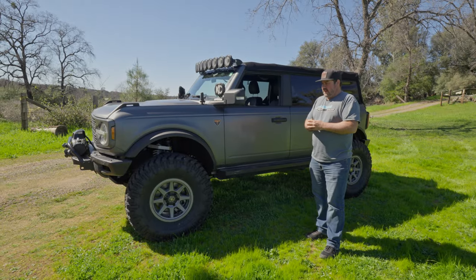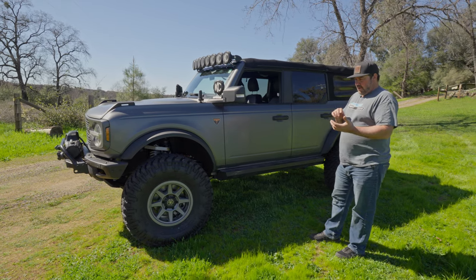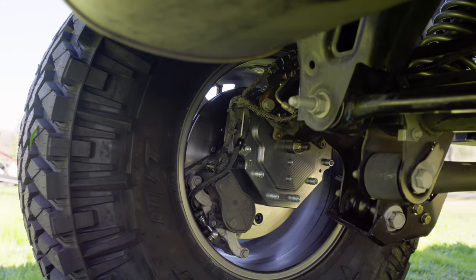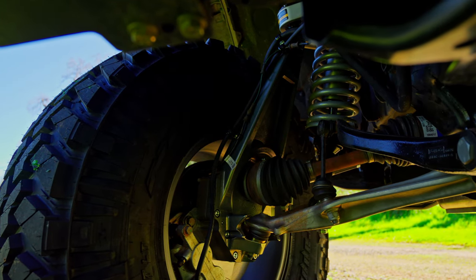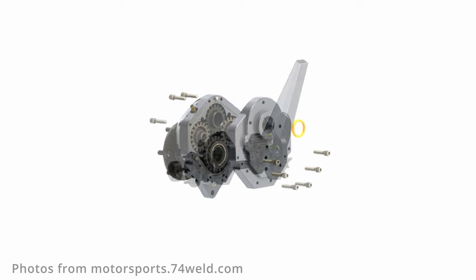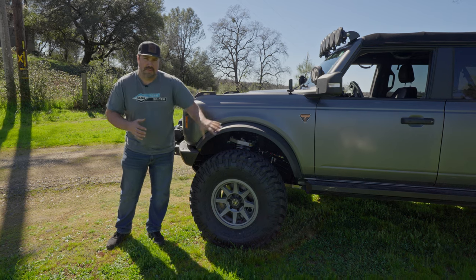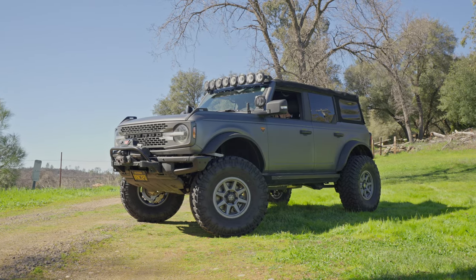It's taken us a long time to get one of these in, and the idea of portals has always been such a cool idea. A lot of companies weren't doing it to the fullest — thinking about ABS, thinking about e-brake cables, all the little details like that. 74-Weld has figured it out from start to finish, and this was a three-day project. Maybe people don't know what a portal is. Basically, the portal box bolts on where your wheel hub is, drops down approximately 3.88 inches, and then it has a new wheel hub on there. Inside this portal box is a gear reduction — in this case, a 22% gear reduction. That 22% gear reduction is pretty much exactly the same as the size we went up in tire from the stock tires to the 38s. By doing the portal boxes, you get 3.88 inches of lift, but it raises the axles too — it just drops the wheels down.